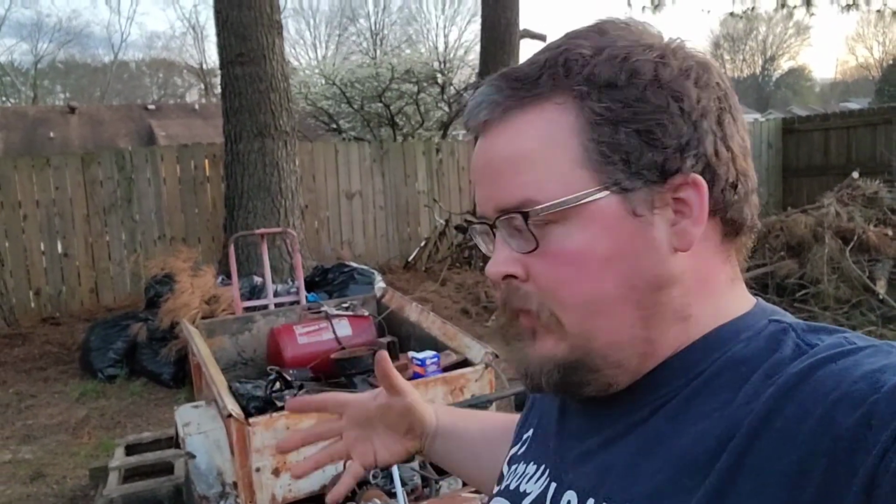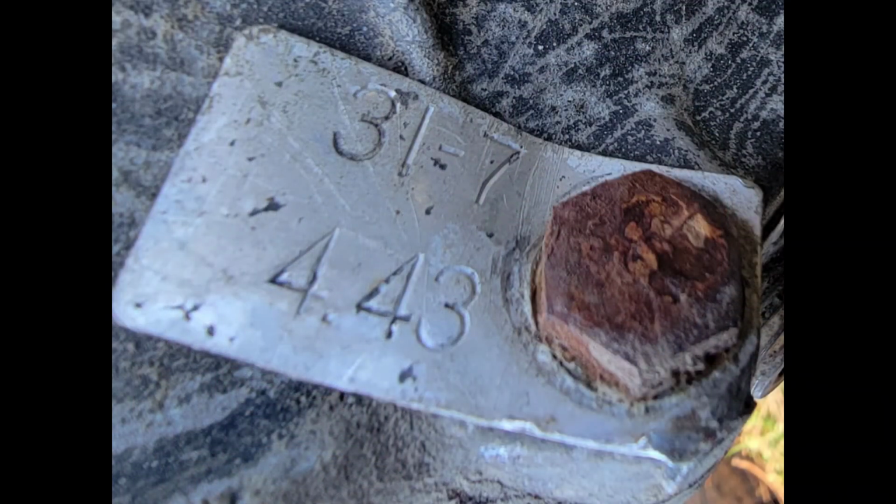Well, I was editing this video and realized I left something out. I've been talking to someone who is extremely knowledgeable with these Cushmans, and sent them some pictures of what I have here, and the different tags and stuff that are on it. And come to find out, both him and I agree that this is most likely closer to a 66 than it is a 68. Reason being, the rear end gear in this is actually a 443, and that was discontinued early on.